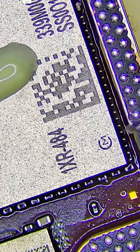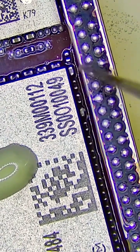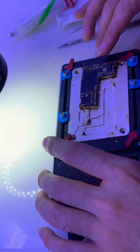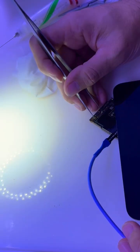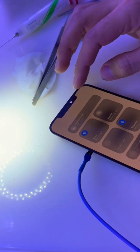After that, I sealed the edges with UV mask to fix up the sides and clean up all that leftover junk from the last tech. Then I aligned everything perfectly, reconnected the boards, and hit the power. Boom! The phone turned on and baseband was back like nothing ever happened.